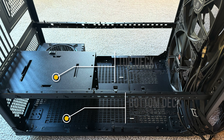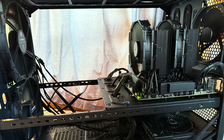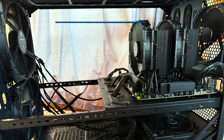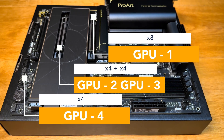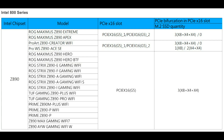Space was the factor I decided to over-allocate. I already had the Thermaltake XT20, which is massive compared to most cases. More physical space will help with the heat factor later on. To actually use that space, I needed to extend the GPU connections physically further from the motherboard. This is where things got really messy. My original plan was to max out the motherboard's unique bifurcation feature of slot 2, splitting one x16 slot into two usable lanes. I bought a bifurcating riser x16 to x8 plus x8, which did not work in an x8 slot that should split into x4 plus x4.